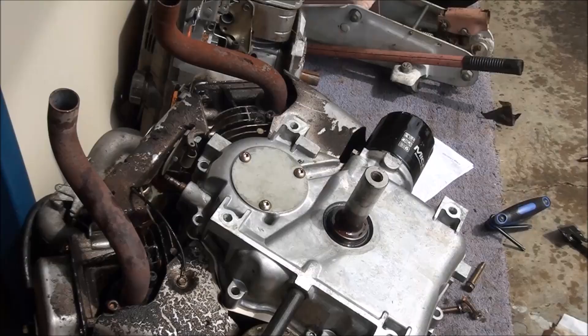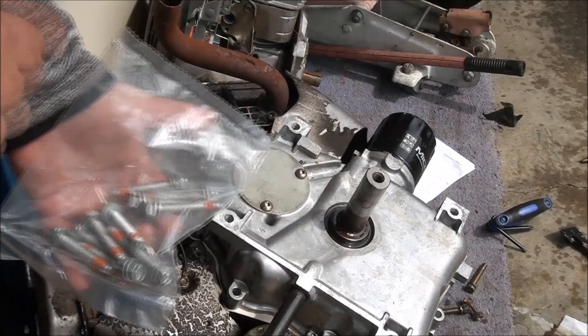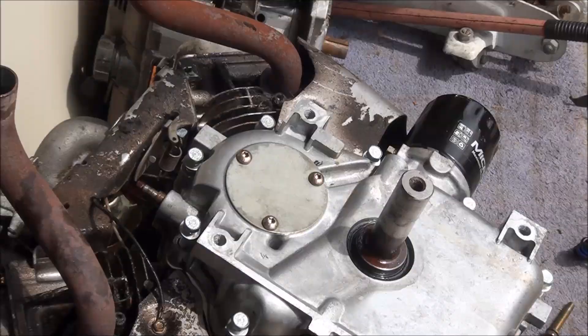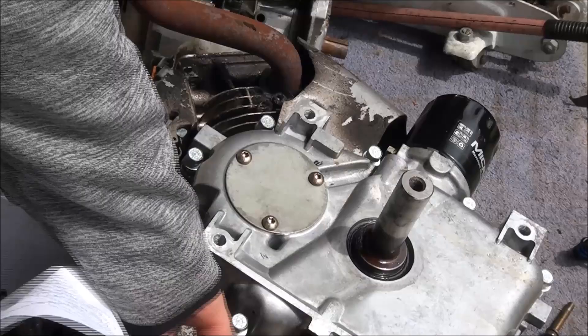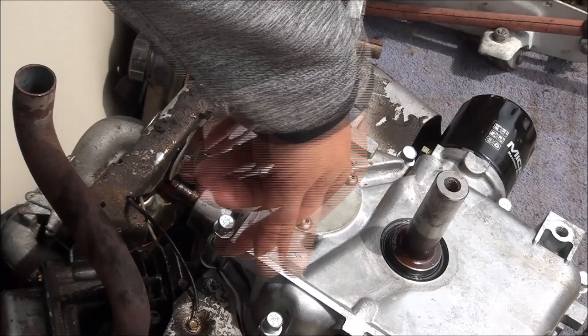So you have ten bolts here and they all go in in a certain pattern — I'll show you how to do that. With the paperwork that came with the gasket it states we need to tighten these down to 300 inch pounds. Now the original service manual states 200 inch pounds, so that's further indication that Briggs & Stratton has updated these bolts and gasket with new specifications. They also give the sequence in which bolts to tighten down — first you tighten them one-third of the way in sequence, then two-thirds of the way, then fully tighten in sequence.